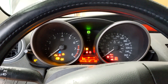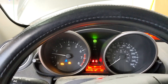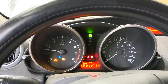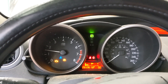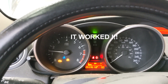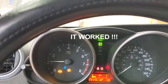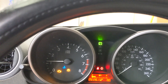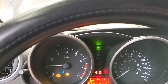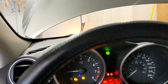Alright, let's start it — got a check engine light, but no AT light and no traction control light. Now this car is my daughter's car. It did have an EVAP code before, but you can see the revs are staying higher longer. I did that once the first time, then I plugged it in again — there was no check engine light — and now it's back. So I'm going to pause the video and move that cable around; maybe there is a fitment issue.